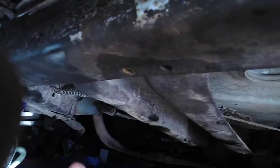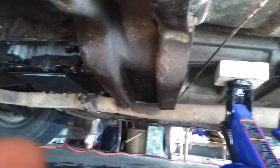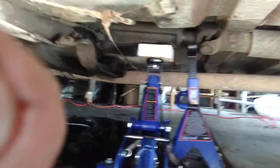I took these two bolts out — there are two nuts on the bottom, two bolts on the top, and washers. Took those completely out of this crossmember. On the other side, the right side, I just took those loose, left them real loose. Then you take the transmission mount bolts completely out in the middle. And of course you've got to jack up the tail end of the transmission. I used a wooden block so it wouldn't put marks on it. That took the weight off of the crossmember.